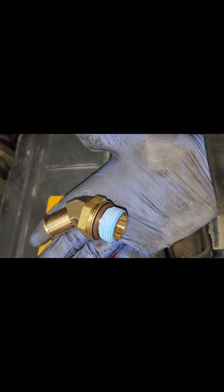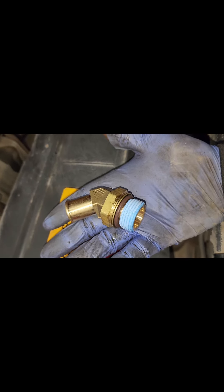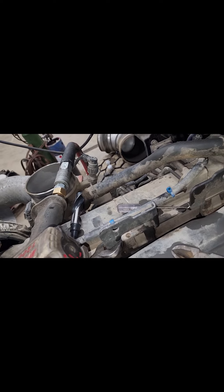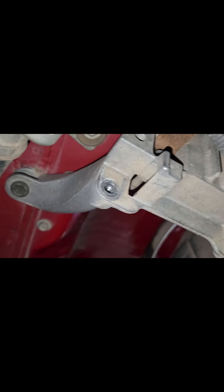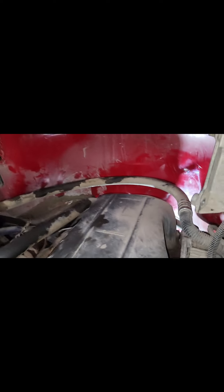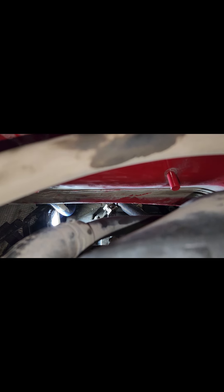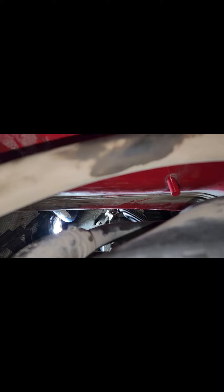We're replacing them with these - these are what Kenworth and Paccar recommend. To start, if you ever need to do this, you're going to pull that tube off your turbo that goes to your air cleaner. Take your air cleaner out - it's four bolts on that side, one bolt on the top, two bolts over here. Then there's a clamp set up down in there. Just cut the zip ties and put new zip ties on.